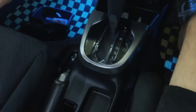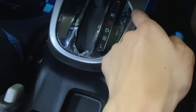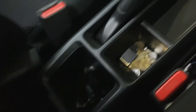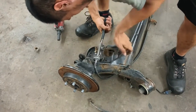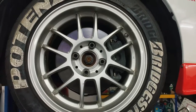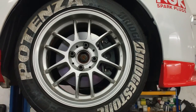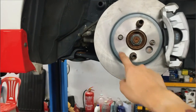After removing the center trim cup holder part, you also have to remove the cover below it — it just pops off. If your car is automatic, the shift lock cover also pops off. The bottom is all clips, and then the whole console comes away. You can see the handbrake cables down there. The brakes are on now.